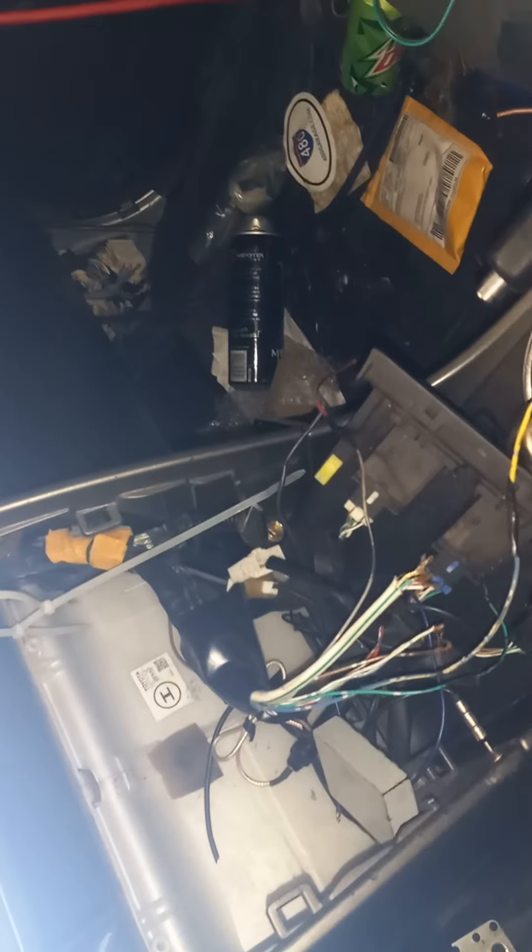I do have a radio over there but I tried to wire some stuff in, checked the fuses, and this part of the harness is just dead — the HVAC, the radio, everything from when they ripped it out is dead. I can't figure out why I can't get power to the radio or to my blower motor, so that's why I ripped the HVAC out.